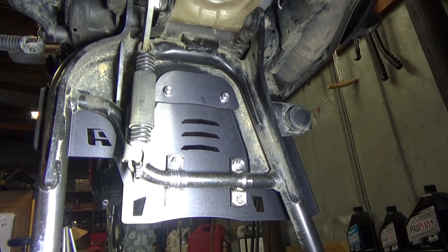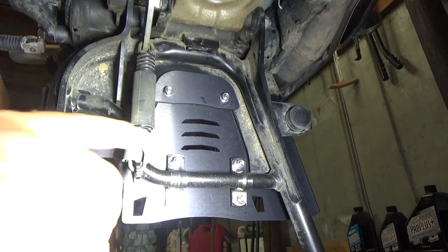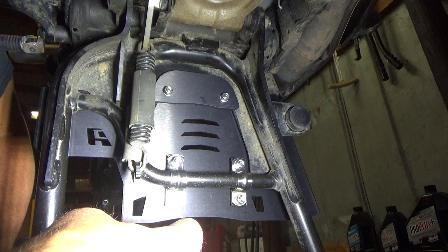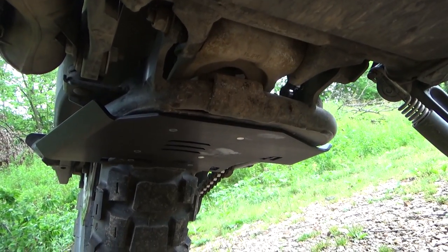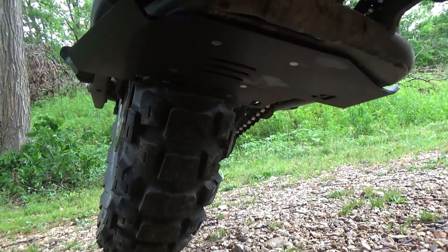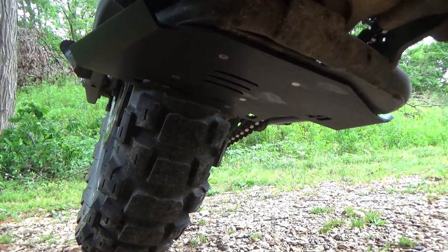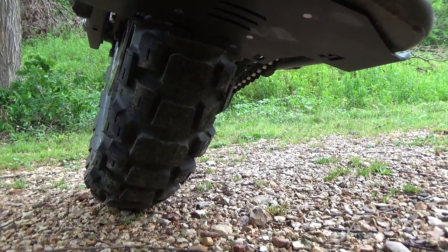That's all there is to it — a very easy install, maybe not even five minutes for the actual install. Super simple. I'll take my torque wrench and torque all the nuts to 7.5 Newton meters and then we'll have that part done. Here's what we got with the center stand up in the up position — you can see now we won't be snagging all this stuff. It'll slide straight back to the tire and make it smooth when you go over a log or rocks instead of hanging up on the center stand. Super cool — thank you all for watching Woodsman Adventures, please click the thumbs up, subscribe if you're not, and I'll catch y'all in the next video.